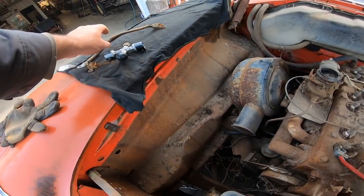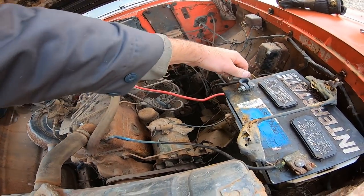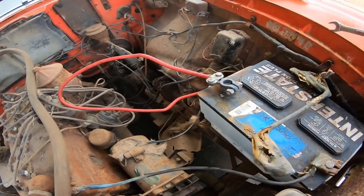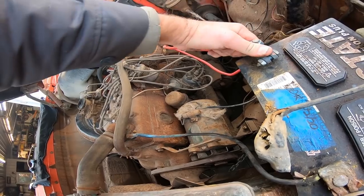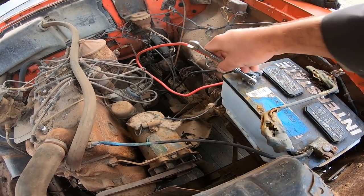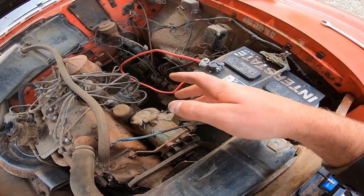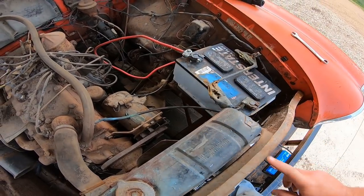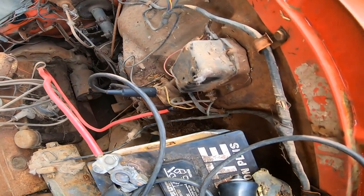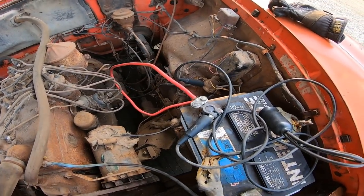Found this laying in my stash. Get on there. Here's how I like to widen those out when they're not the right size - just get in there with your half inch wrench. I'm going to go grab my starter button. If this battery is any good, and that starter is any good, and that solenoid is any good, and all the connections in between are any good, this thing might just turn over. Got our handy dandy push button starter ma-jigger thing here. Hook her up to the starter solenoid post right there. This one's only got one - Fords like to have two and you've got to figure out which one to hook up to. Good job Mopar.